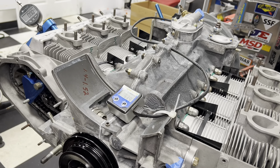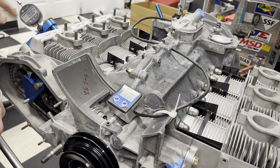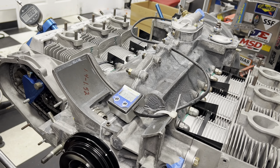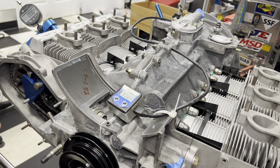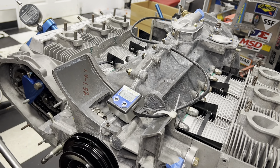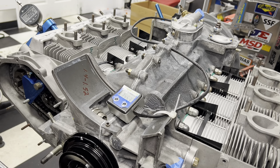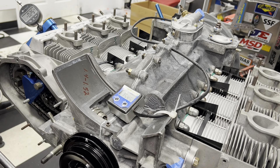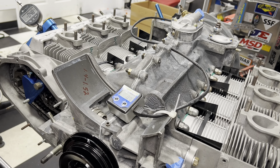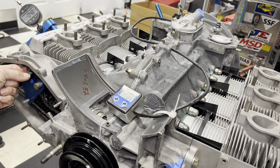We're going to go all the way around and watch our Z1 spot come up. We set the lash on that guy at 0.1 millimeters. We're at 335 degrees. Around 345 degrees we start to see the cam move — about five hundredths of a millimeter open. We take this guy right up to 360, and we're back at zero. We're at 0.48 millimeters of lift.